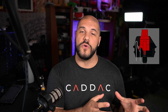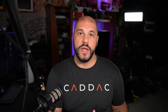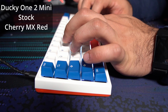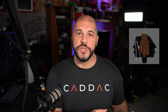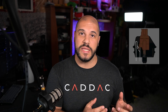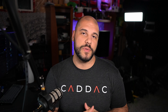Linear switches are typically focused on gaming. They're a lot quieter and don't have much sound other than when they bottom out. There's no bump in the keystroke at all — a very common one is the Cherry MX Red. Tactile switches are basically a good middle ground between clicky and linear. They usually have a bump and are not nearly as loud, but they're a good balance between a gaming and typing experience. The most common tactile switch is a brown — usually Cherry MX Browns are the ones most people know about.